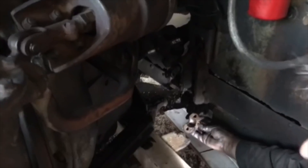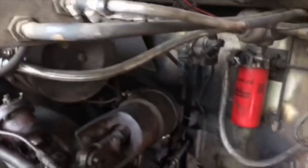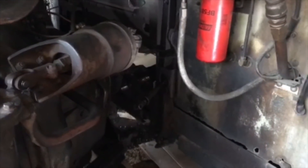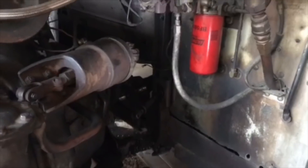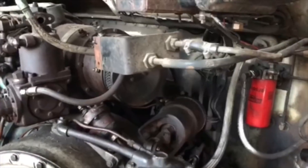Okay so when you remove the cradle on the back side you can take these two bolts out of this piece and it comes off, and that hook is caught on there. So once you lift it up off of there then you're free. And then if you take the two pins out of the upper here, that'll drop it down. Drive shaft is disconnected, all the grounds, the battery cables, the air lines, fuel lines — everything is disconnected and free. This engine should come out.